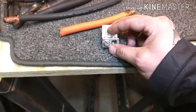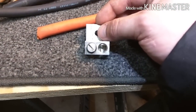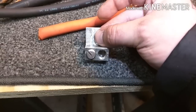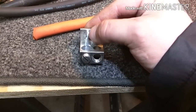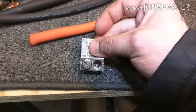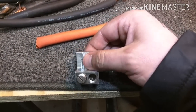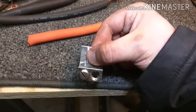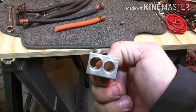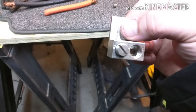If your amp has power on one side and ground on the other, this huge connector with the pre-drilled hole isn't going to fit as-is — it has a nub that goes up in there. All you have to do is take a hacksaw and cut down the middle. Right where the pre-drilled hole is, cut a line straight down. On my amp's ground, for example, you cut that metal nub off — you'll just have one nub sticking out — and drill a smaller hole for the torque screw input. You've got two 1/0 or 2/0 gauge wires going to one input, and it's night and day for $3.50 per amp.